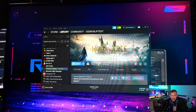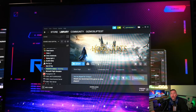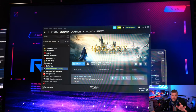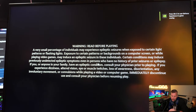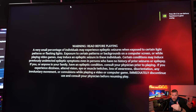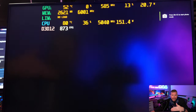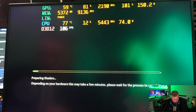Most likely, my recommendation in general, if you want a quieter fan system, is you've got to tune the fans with your own manual fan control, because there's usually a decibel plateau. Once the fans hit like 60%, it starts to get noisier. And then at 80%, it gets extra noisy. And then at 100% fans, it's super loud. So you've got to tune it to where your limit is and then try to get the most acceptable performance for that fan level. That's just generally what I recommend to pretty much everybody.